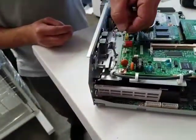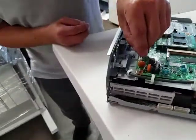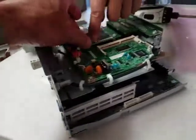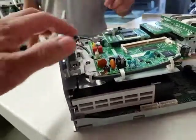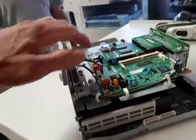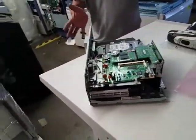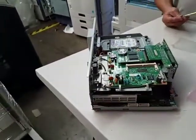So, lastly, don't forget to connect those RJ45 connectors, otherwise when you plug in your telephone cable, it's not going to make a contact. So you plug it into the board there, and there you have it. And make sure this one is tight down. Always make sure that this little board does not pop out, because there's a little connector. I'm going to go ahead and pop it out just for demonstration purposes, just like that. A lot of techs make that mistake where when they're handling the board, they accidentally pop it out. You got to make sure, just gently with your finger here, just press down, make sure it's nice and seated, just like that. If you ever get a message that says please wait, it's because you accidentally popped that board out.